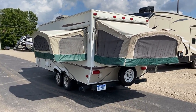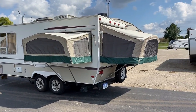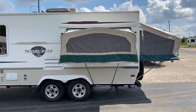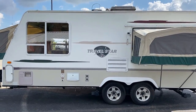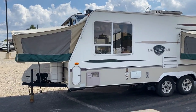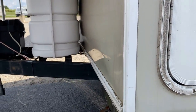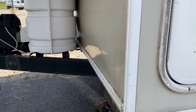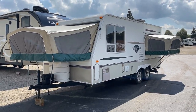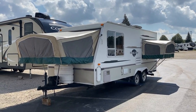Another indication of this is that up close on this camper you'll actually see lots of different spots of little wavy skin — that is delamination. There are different ways to get delamination: the most common association is a leak that caused the walls to start peeling apart, and that can be one cause. But another cause can literally just be stress — if you take something that's all pressed together and start twisting it hard, you're going to have some wrinkle spots. You can see that funky little crease at about a 45-degree angle right there — that is from stress. There may not have actually been any water in that area, but because this thing has unfortunately been twisted like a shoe box, the skin and the skeletal structure below have come apart a little bit.